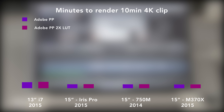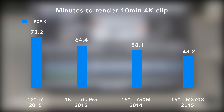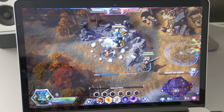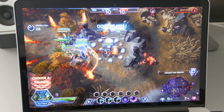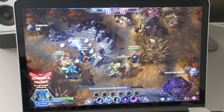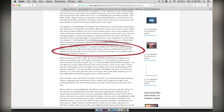Let's look at video editing. The performance gain of the new AMD card is pretty dependent on your application suite. If you're primarily working with Adobe products like Premiere and After Effects, you can probably save money and go for the base model — you don't even need a discrete graphics card at all. For Final Cut users, there is a noticeable improvement of about 15–20% over the 750M. The discrete card on the 2015 is actually a rebrand of an older AMD chip that's been around since 2012. I really wish Apple had put in an NVIDIA 860M or 970M instead — those Maxwell chips do great in games and video editing. Apple claims up to 80% performance increase, but in general it's around 15–20% from what I've seen.